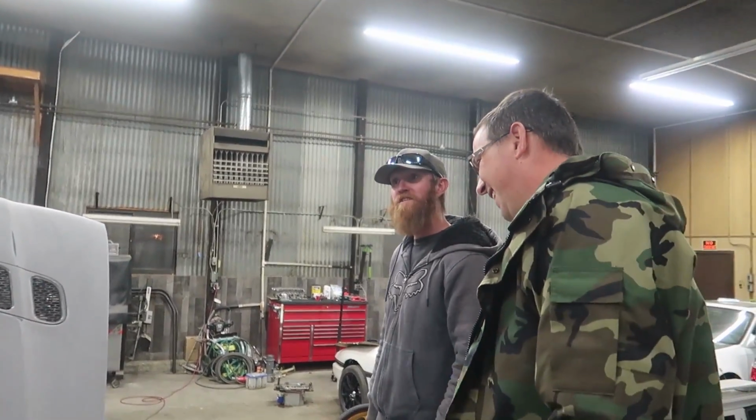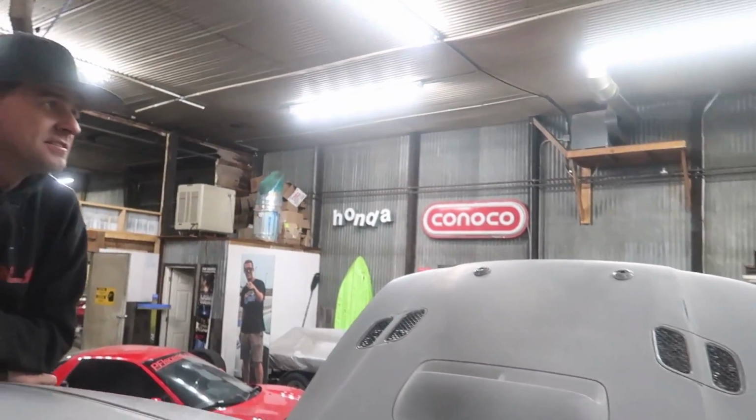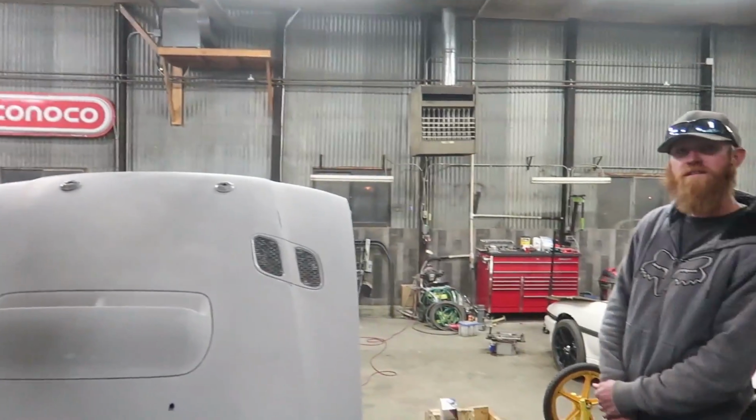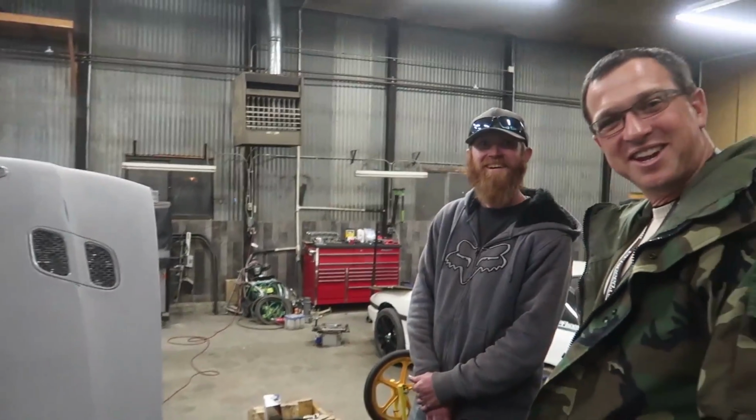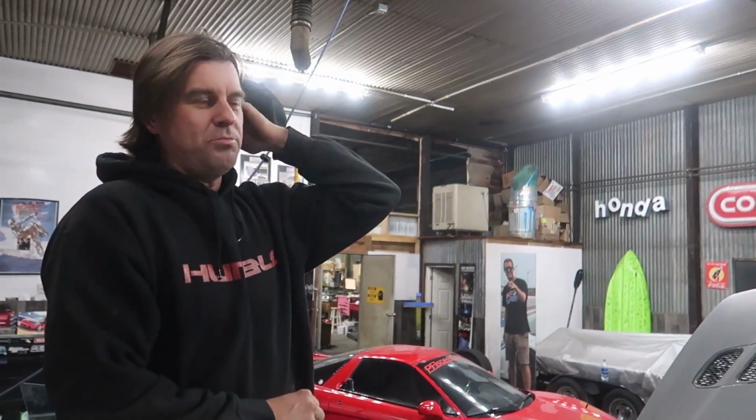And we fought that solenoid. We'd have been done so long ago if we didn't fight the solenoid. I was probably too stubborn. I did not think it was that. I kept asking Jamie, is there a line that fell off the gate? How many times did I walk over? I'm like, the lines are on. The lines are fine. Did I blow a coupler? Nope, that was boost cut.